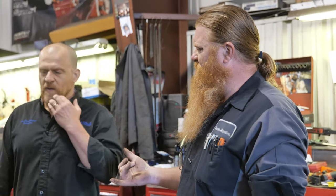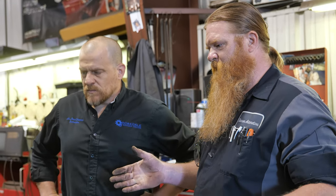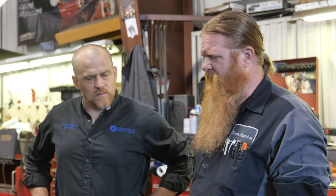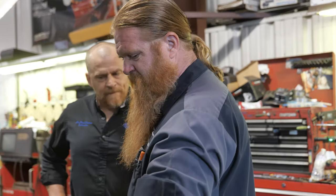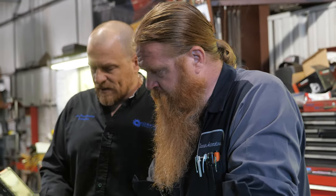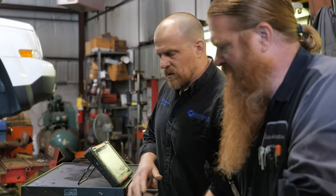But we had a 2646, which is a Honda code. I see them for their cylinder variable valve, actually when they shut three cylinders off. I had that code too. I don't know if it's a valve pause system or how they describe it. I've never seen it on a GM, so I did have something with that, but I don't think it was one of these. I'm going to focus on the O2s. We spoke over the phone about these grounds and you were messing around with that, and they're not where they're saying they are.